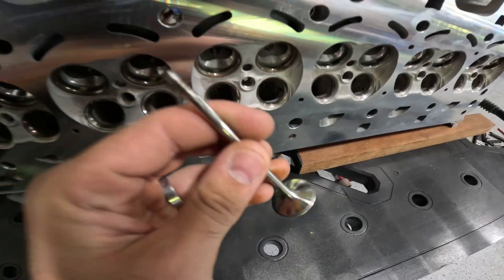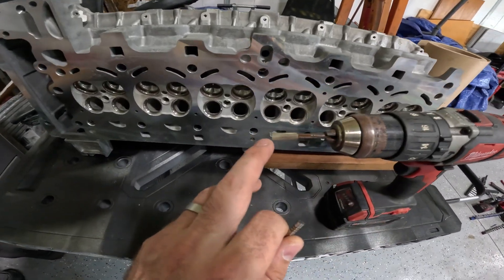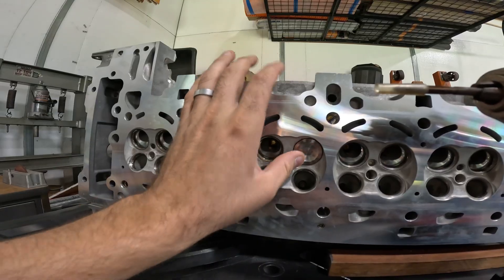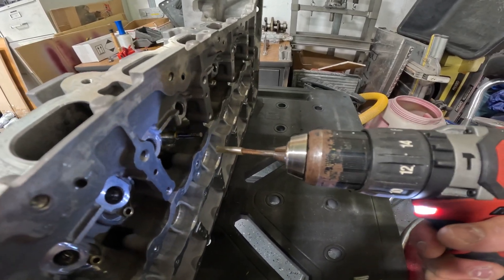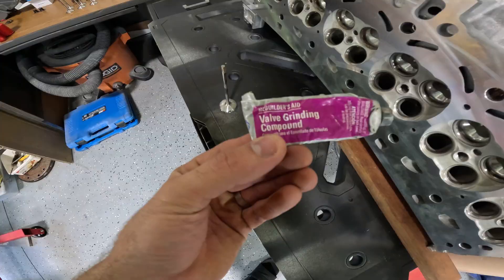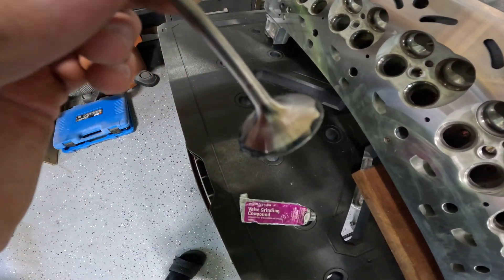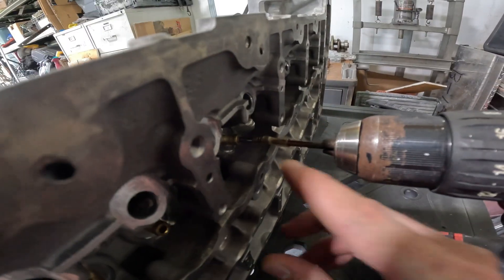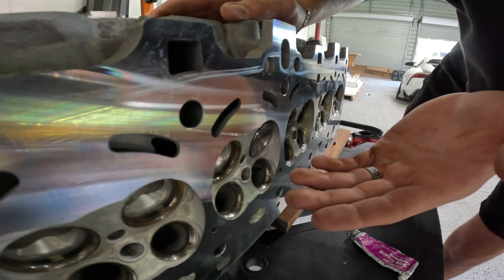I'm going to show you guys how I do it — there are multiple ways. I take a drill and some plastic tubing where the valve goes in very tight, connect the valve to it, and then turn it on. You don't want to spin one way only — you want to spin a little bit this way, a little bit that way, about four times. This is the compound I use for lapping, you can get it at your auto parts store. Apply about this much to the valve. So we put the valve in and connect the drill. As you're spinning, you do want to apply pressure with your finger to the valve, because without pressure it's not really going to seat correctly.